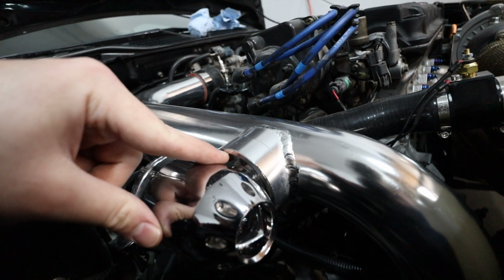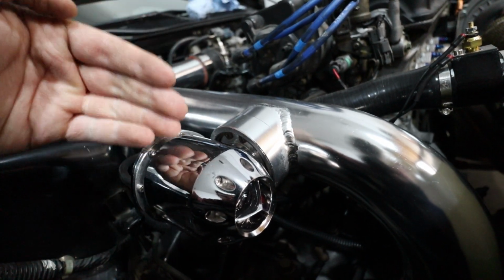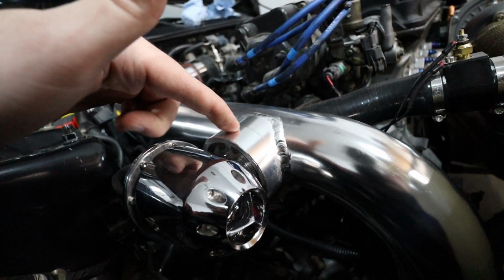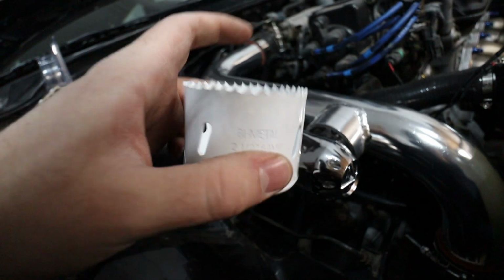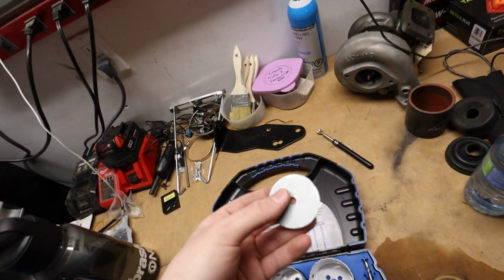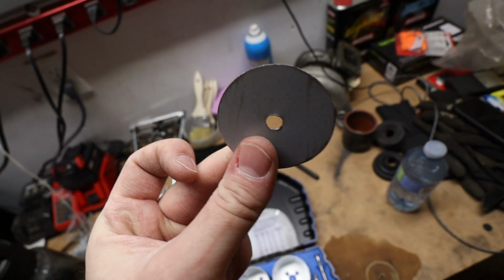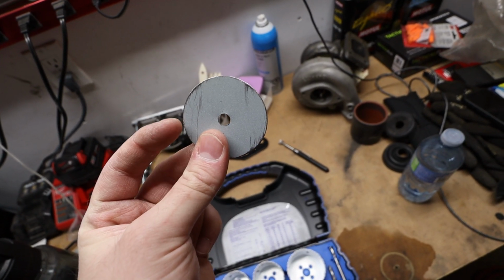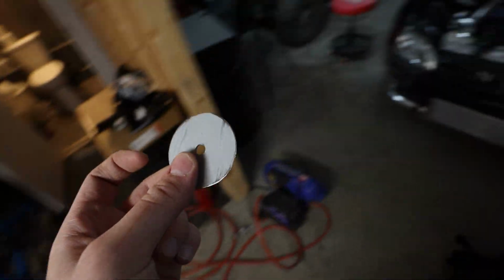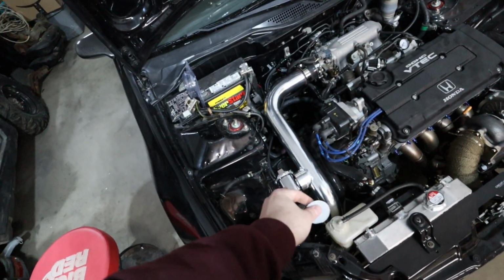The one that we drilled sits so far in there that everything else is exposed, and you would have to lay thick beads because behind the plate everything's so much more deep and recessed for the rubber O-ring. So unfortunately my biggest size is too big, and the one step down could work, but it's just a little bit too small. This is smaller than the O-ring that seals the HKS blow-off valve. So it sits flush where the valve would sit, but then there's so much dead space in front of it, and you'd have to lay really thick welds. And if you know anything about welding, this aluminum is Chinese and super thin. You're laying thick dimes and there's a lot of heat in there.